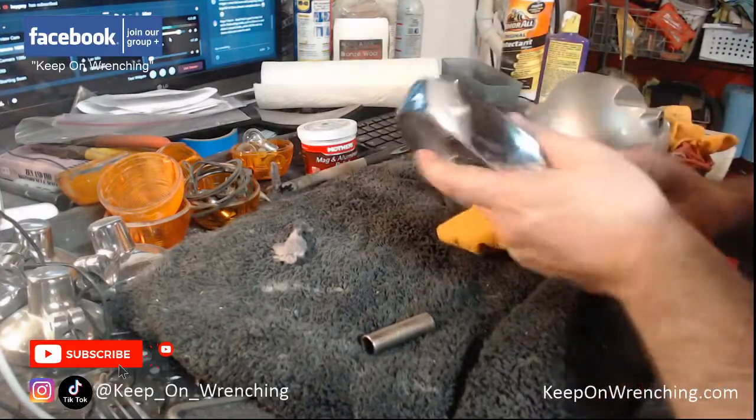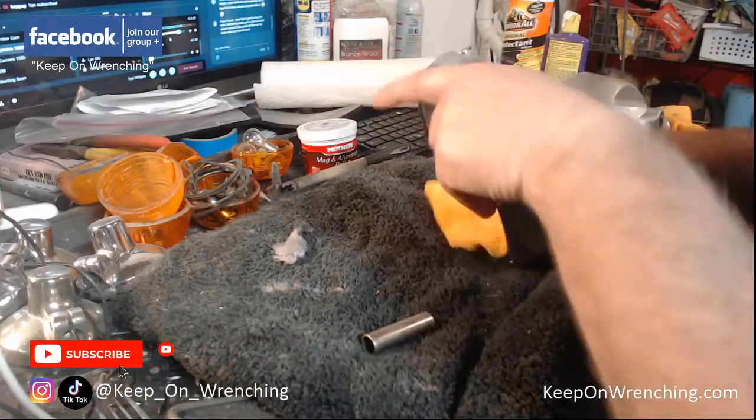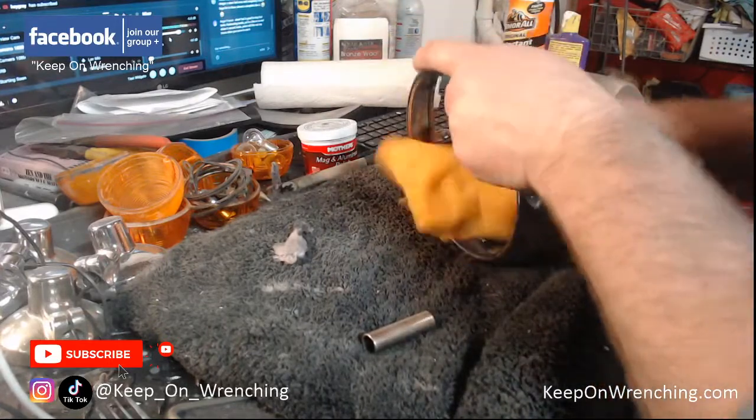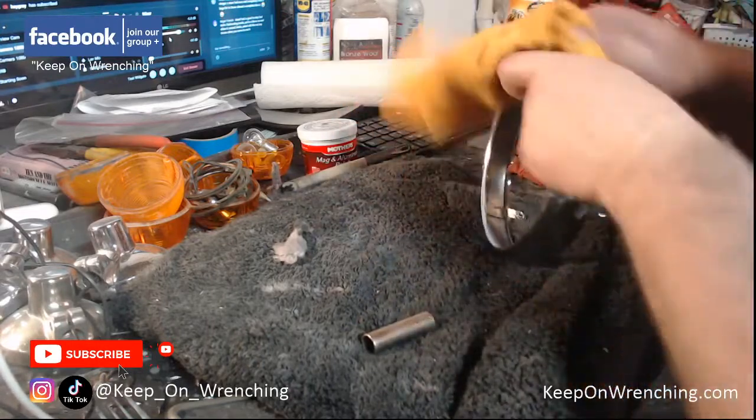Diesel fuel's good to stop tanks from flash rusting. Put a liter or so in and sluice it around inside. Petrol will thin out any traces when you come to use it.